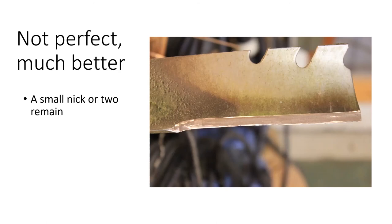If you take your blades to a sharpening store, a professional sharpening outlet, you'll get it back and there will be absolutely no nicks in it. They will also have taken off a little more metal to get the nicks out of there before they give it back to you. So over time, over years, your blade will eventually get a lot thinner looking here at the end. And that might indicate it's maybe a time for a new blade eventually. But again, by hand, it'll last you probably the length of the time you own the lawnmower.